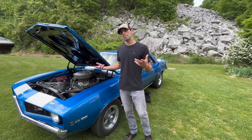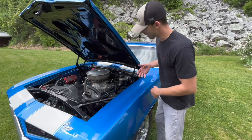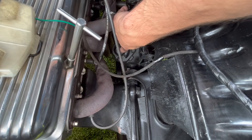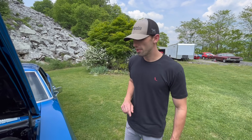While still on this side of the car, we'll talk about power steering. For a Z28, it was actually a quick ratio steering. The power steering gearbox was the same on all Camaros, but the pitman arm would be different for a Z28, an L78, or a Copo car. Center to center is how you measure it, and it would be 5.8 inches long.